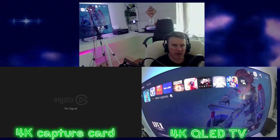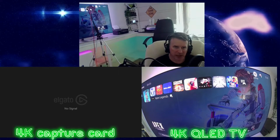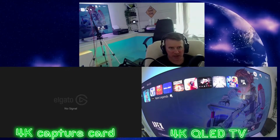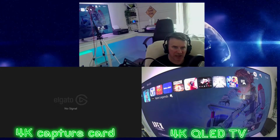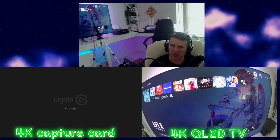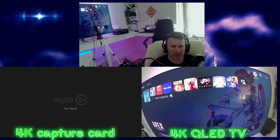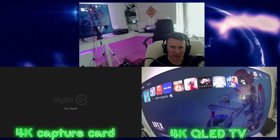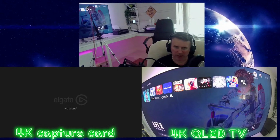Right, so what we have here now is on the bottom left, below me here, I have a direct capture of the Elgato, and then if you look in the background, I'm actually filming the 4K television at the same time. So if you need to capture, split the signal to capture one to the telly and one to the Elgato, and you're using something like a PS5 or an Xbox, I believe Xbox HDCP is disabled by default, but on a PS5 you will need to disable HDCP. Essentially HDCP is a form of copyright protection, and it stops you copying videos, but you should be fine for capturing things like video gameplay. So I will show you that.